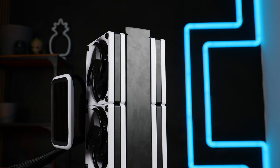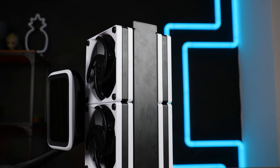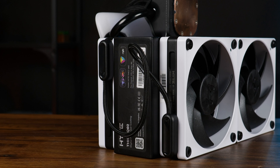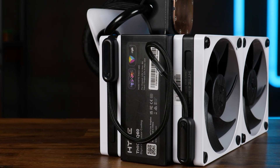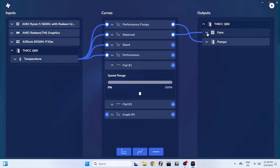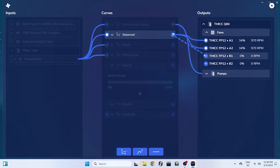But the radiator is like double the thickness of what we usually get. So yes, I would absolutely advise you to do this. And by the way, it looks kind of cool. Fun fact, the AIO is built with this kind of setup in mind. Because if you want to connect them, you can still use the leftover Nexus connector and then just route it over to the other side. You will need to somehow hide the wire, which is going to maybe be visible at some point. But the software will detect everything immediately — it will understand that there is a second set of fans sitting on top of the AIO. So that's really cool.